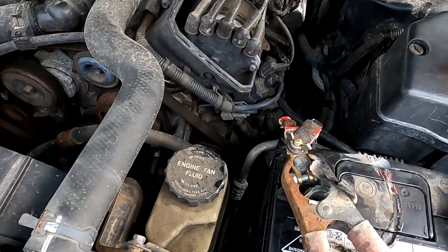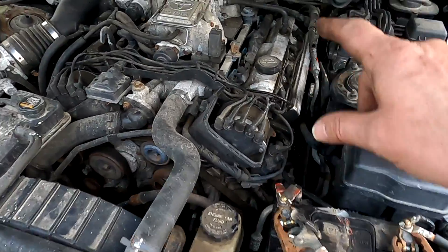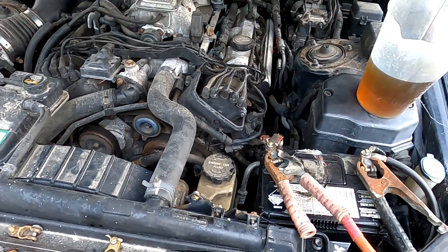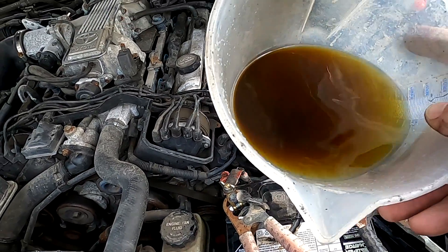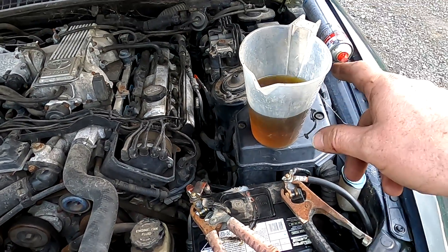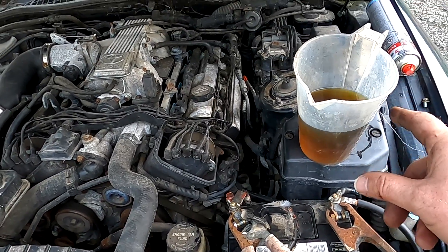Okay, get some flames. So this one was generating enough pressure to pop the dampener up, but it wasn't flowing enough fuel, and the fuel was - you can see in there that it is absolute crap and it's absolutely disgusting. So that's a surefire thing that it isn't going to run like it should. That's well past it.